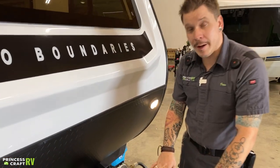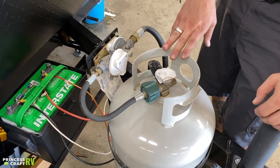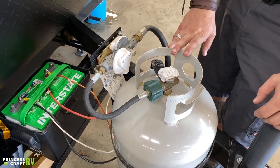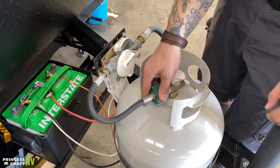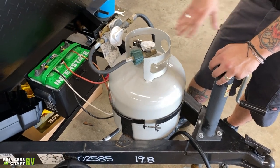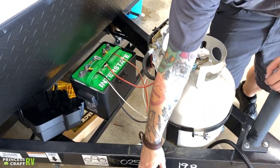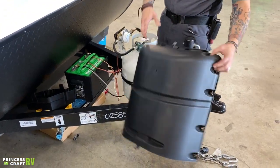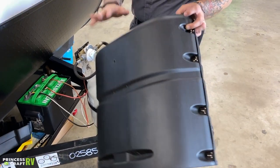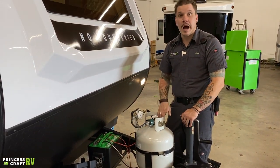Hopping up here, we have a 20-pound propane cylinder. This is going to be full for you when you do pick up your unit. Open and close valve on the top, clearly marked in the open and close position. This is the same variant you're going to find on any gas grill. To service the tank, you're going to go ahead and remove the pigtail here and also loosen this tension band. From there, you can pull this tank out and take it to get filled. Take advantage of any exchange programs. This is all covered by the propane cover here. The hole on the rear of the tank should be facing the camper itself — line it up with this stud and this wing nut to secure that cover in place. That cover is not only going to keep any weather off of the tank, but will also protect it from road debris and rocks while going down the road.